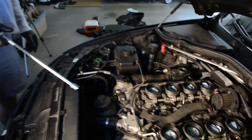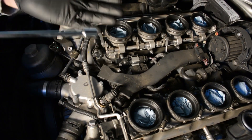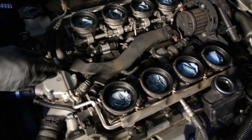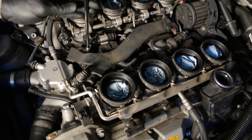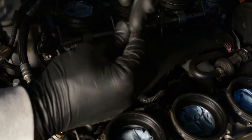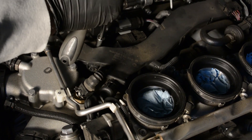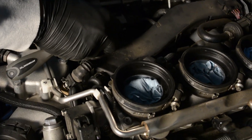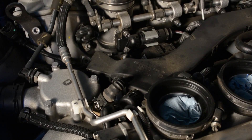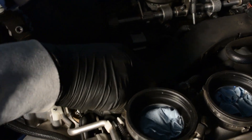So now that the plenum is off, I'm going to remove or unbolt the wiring harness, and then we might need to unclip a couple things. From there we'll lift up the harness and access the two throttle actuators — you can see the plugs there and there. We'll access them kind of through the front. First we'll just get the harness loose here, and be very careful not to drop the bolts or the nuts — it would be more of a pain to find them.